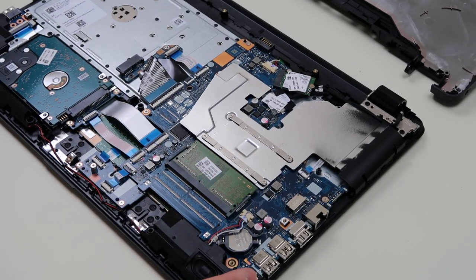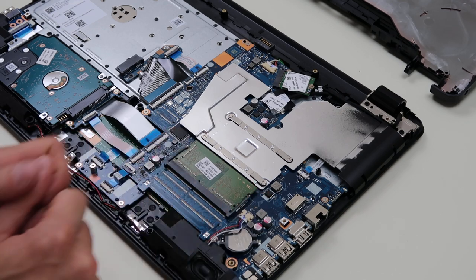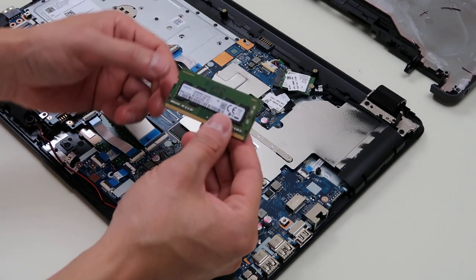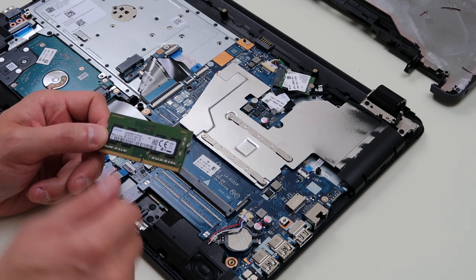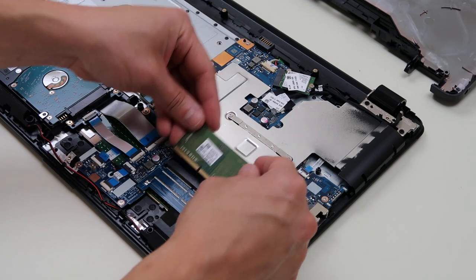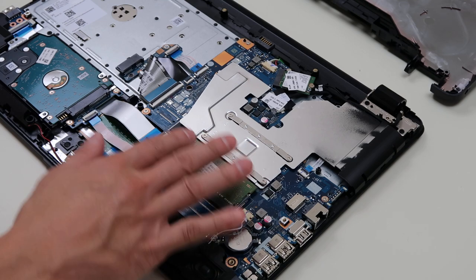Now if you notice your RAM — if you've gone into computers or laptops before, you know how these things are usually kept in. There are two spring-loaded arms here, and it's spring-loaded and holds it in. So all you've got to do to remove your RAM is slide these arms away and the RAM just pops up, then slide it out. If you need to know which kind of RAM you need, check out the video link in the description. Keep in mind there's a long end and a short end port so it can only go in one way. Slide it back in, make sure it's in there snug, then push down to secure it — it snaps right in. The RAM is pretty easy.